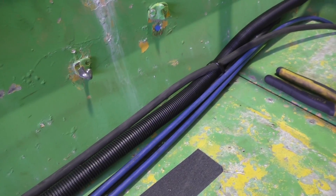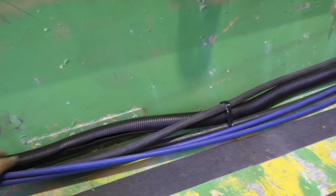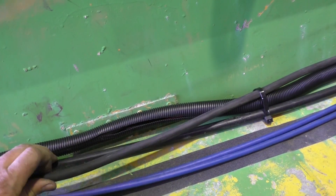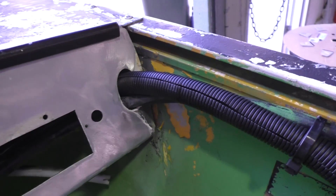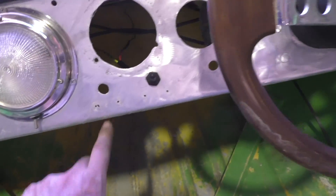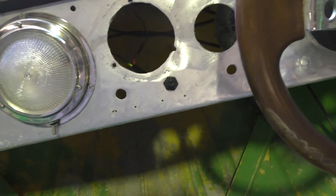From here on I cable tie it to the steering cable. I could have used a huge conduit and put everything inside, but personally I find that a bit of a maintenance headache down the track. I'd like to have all these accessory wires protected because they're quite delicate, but I'm happy for the control cables, the wiring loom for the outboard, and the steering cable to be separate so I don't have to pull everything apart to change one of them. As it comes up the front here, it comes through the dash and the conduit just stops the wires chafing. Underneath, I've also got all the wires just cable tied up — in occasional places there are holes in the metal, so I run a cable tie through and bundle the wires to keep them up together.